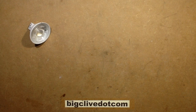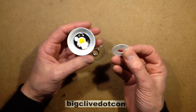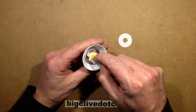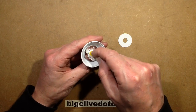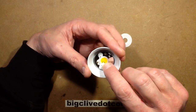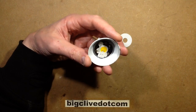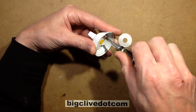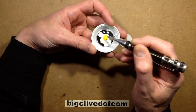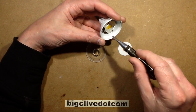Opening this lamp up — I have to say I've already had a little exploration. The lens comes off and there's a plastic disc, and it exposes a traditional COB with a fairly hard coating — it doesn't feel rubbery like it usually does; it almost feels like a fairly hard plastic over those LEDs. You can see three, what I presume to be roughly one-watt LEDs, obviously linked in a circle. And if you take this assembly out, this isn't heatsink compound — this is just glue. That plastic disc was glued in and broke while I was taking it out, which is why it's held together with tape for this video.